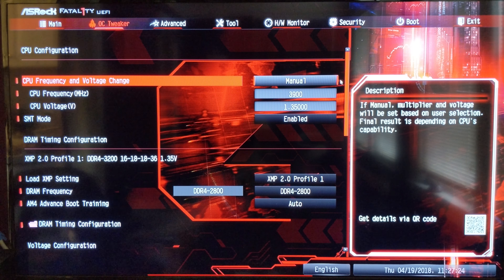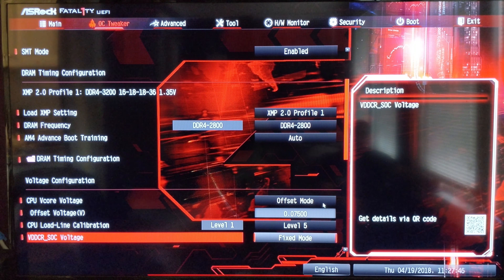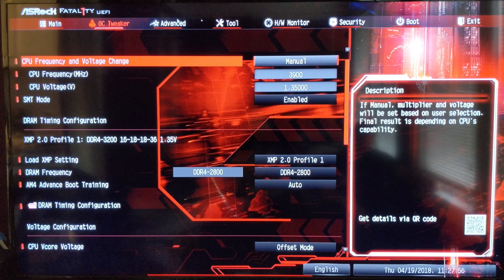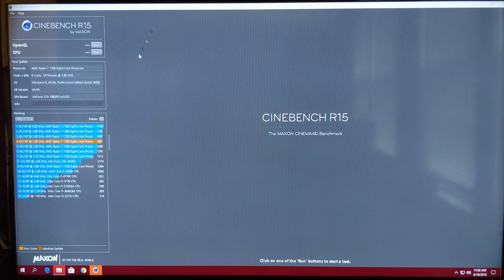First, my apologies — I'm recording this on a camera because I do not have a capture card currently and I don't want to introduce any lag using OBS. I want to show you my BIOS settings right now: running at 3900MHz with the Ryzen 1700 and 2800 memory, which is all this motherboard would push stable, using an offset of 0.075 volts. I know it's a little high but for 3.9 it's been working. I'm using BIOS 3.40 on my ASRock X370 Gaming K4.